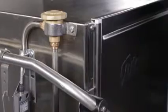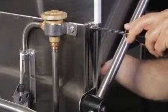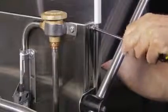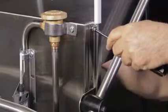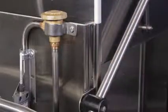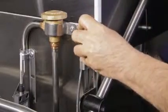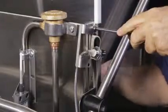the wall. Remove the 1/4 inch 20 by 3/8 screw from the door guide at the left rear corner of the machine at the top on the A4. This will be the second from the top on the A5. The A4 and A5 use different mounting locations in order to clear the door bar. Install the door switch bracket in this location with the 1/4 inch screw you just removed.